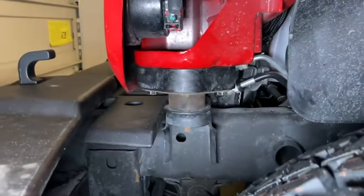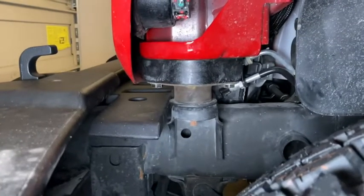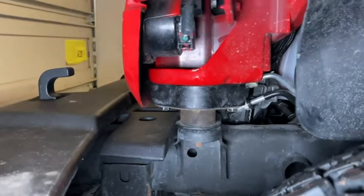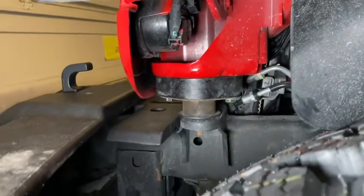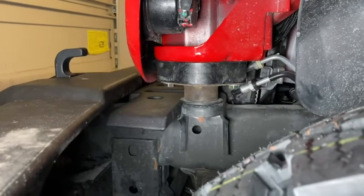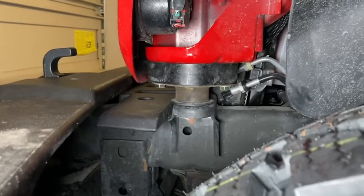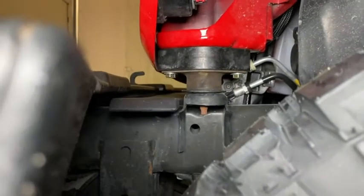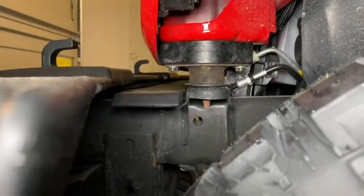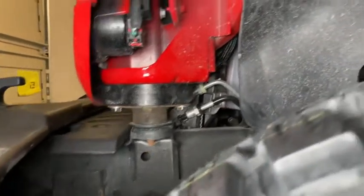Here's an up close view of the body mounts after they're installed. The first two are right behind the grill. So when you do this type of a lift, you'll have to remove the front grill. You can see the spacer there. They use the factory spacer bracket, but they come with aftermarket bolts that connect to the factory lug nuts, at least with the one that I have. Overall, pretty easy install. Took probably, I would say, 4 hours or so.